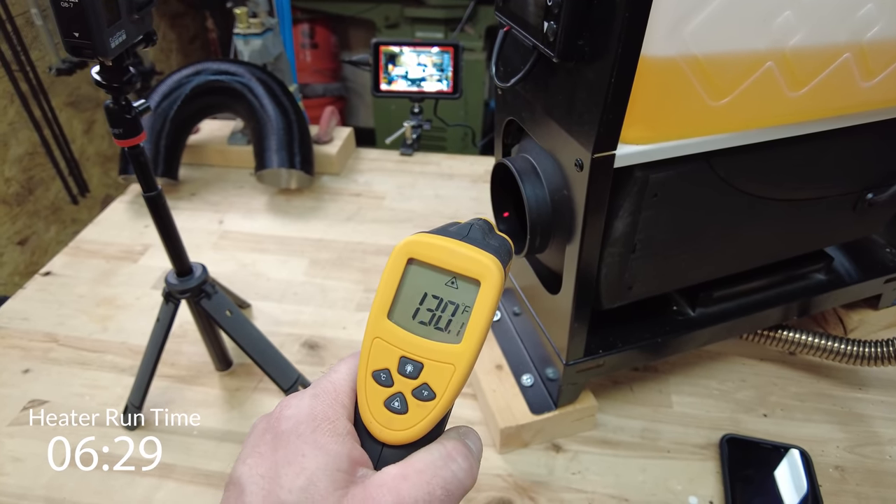The fact that I can run this on my Jackery 500 is a huge plus — it doesn't pull more than 10 amps during startup or shutdown, and running at about the medium setting draws a steady two-and-a-half amps, which is more than enough to get me through a night. As far as cons go, that big list of potential failure points is always going to be in the back of my mind. I don't know how long this thing is going to last, and I won't lie — it just feels cheap. Cheap sheet metal, cheap parts. You get what you pay for, but that doesn't mean it won't work well. The question is really how long will it continue to work well.